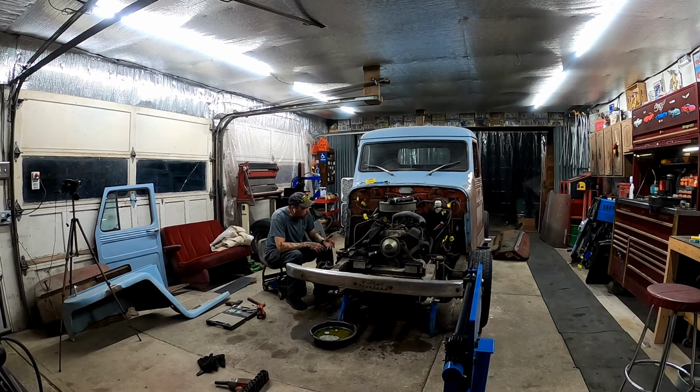Underneath there, I got under the drive shaft, trans mount. Then there's two bolts up here for the motor mounts. I'm just gonna pull it. The motor mounts actually stay with the truck. I gotta do some work on them. They're not the prettiest. Somebody made them, and I'm just gonna make them look a little better if I can. But I'm gonna pull it out with the motor, and then I'll take it off the motor. We'll put it back in the truck. It's way easier to just do it that way.